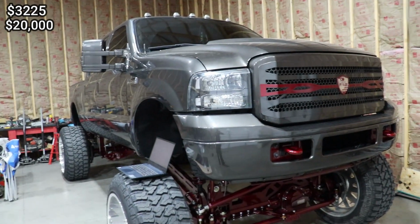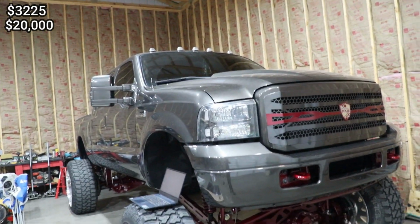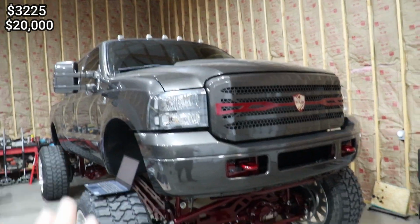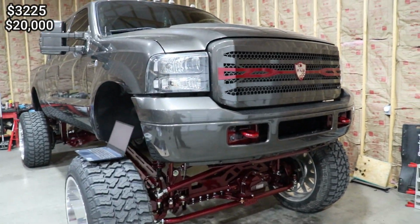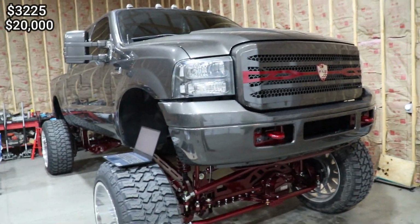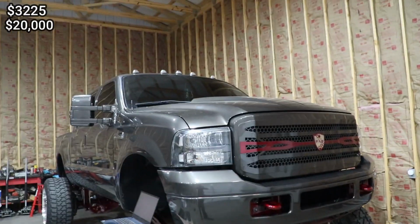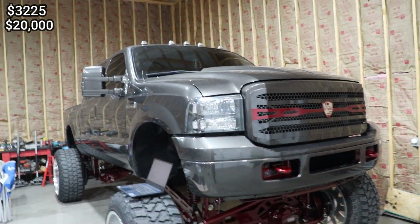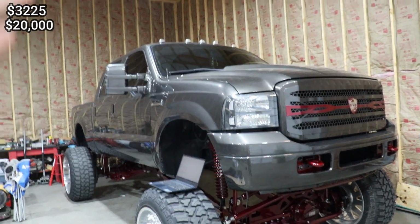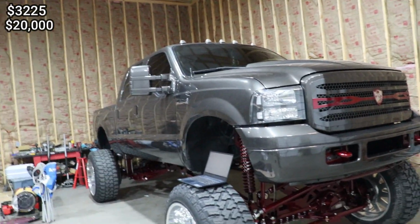That's probably one of the most important things, is the tuning and just watching your temperatures, making sure that your truck is running healthy. Like I said, I put over 20,000 miles on this truck. When I got it, it did not have blown head gaskets, and as of today, it does not have blown head gaskets. So that's 20,000 miles, all on oversized wheels and tires, all with a tune. If anybody's wondering, while we're on the subject, I'm running the SRL from Gearhead Performance, tuned through the SCT X4, which is what I watch my oil temp and my coolant temp with.